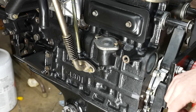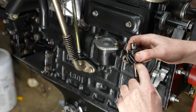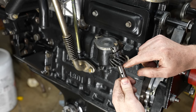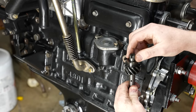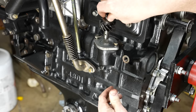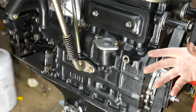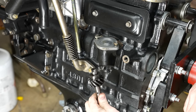I did get a new cam gear. This is the old one. So my idea here is if I just cut this old gear off and then hook a drill extension on here, I can prime the oiling system just by running it through there. So that's why I'm leaving this out for now. We'll give it a shot. Maybe in the next video, I'm thinking, because things are going really slow right now.